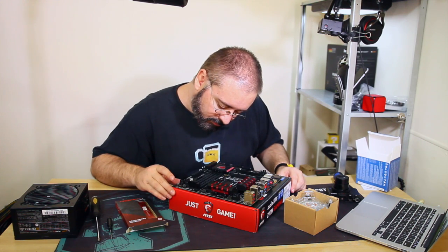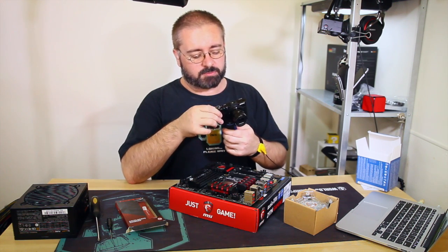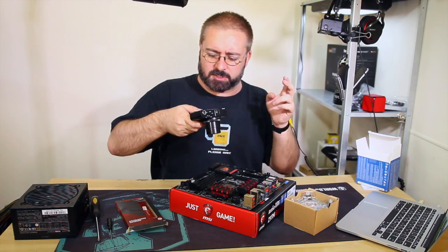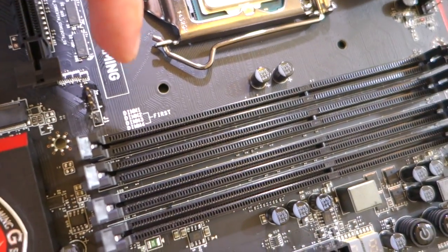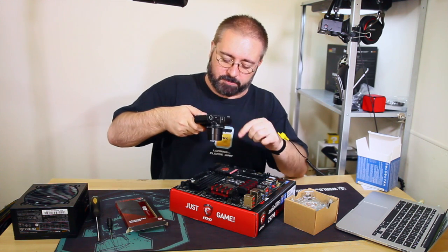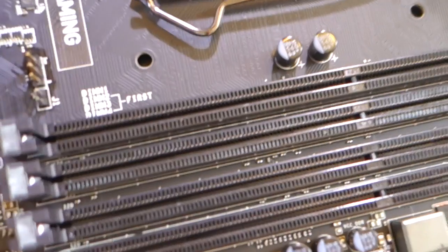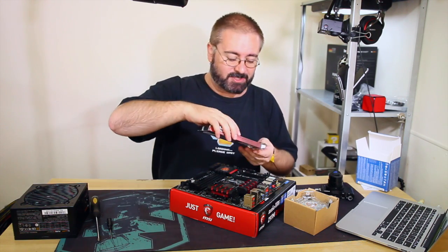It's actually written on the motherboard - DIMM 1, DIMM 2, DIMM 3, DIMM 4. In modern motherboards with dual-channel RAM, if you're putting two sticks in at the same time, you should put them in certain slots so they work together properly. The system treats the two sticks as one to increase speed. On this particular board it tells you right there: use DIMM 2 and DIMM 4. If that's not printed on your motherboard, check your manual - it will be in there and it is important.